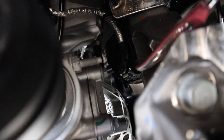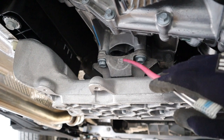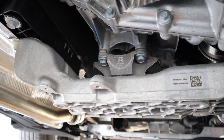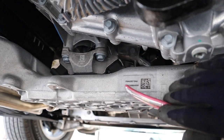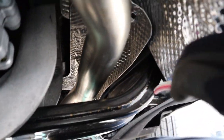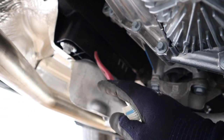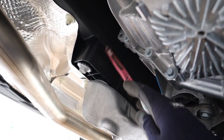There are three main engine mounts on this vehicle. The two at the front are actually active engine mounts — you can see where the driver's side mounts to the subframe, and there's one on the passenger side too, a little difficult to see with the differential in the way. The last engine mount is at the transmission at the back at the tail housing, mounting to a cross brace. Interestingly, that cross brace mounts up to the body on one side and a steel brace on another side, but on the driver's side it mounts up to a piece of plastic that mounts to the body.